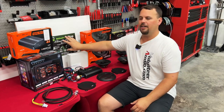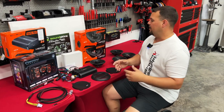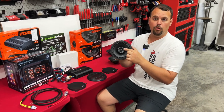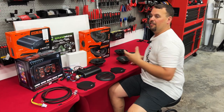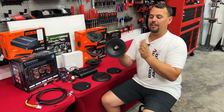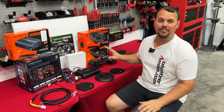We're going to wrap those front speaker pods in Soundskins — it's a sound-deadening material that's going to give us better sound and better mid-bass, making those enclosures even better in the front. We're going to do the Hertz 6.5-inch SX165 Neo; the SX series has the tweeter in the middle — excellent speaker, great full sound, and that tweeter is going to give us way more than enough treble. We don't need to add that in the rear, where we're going with our mid-bass. SV mid-bass in the back, one set of tweeters in the front — it'll be plenty bright. This sounds so good together; it's one of our favorite systems.